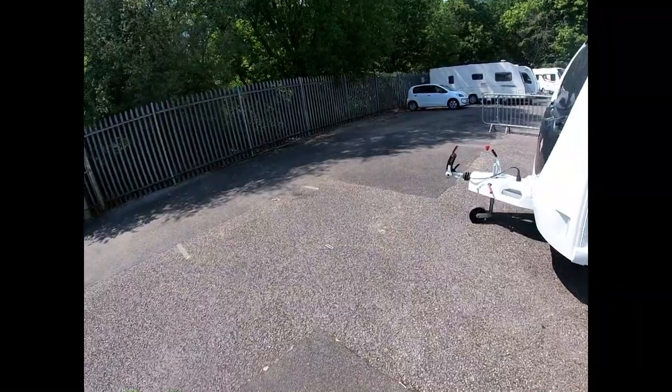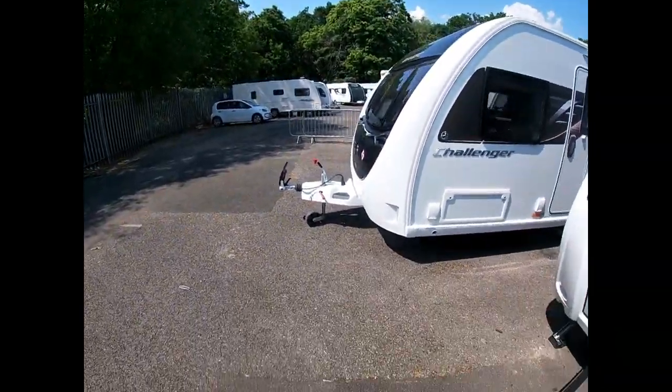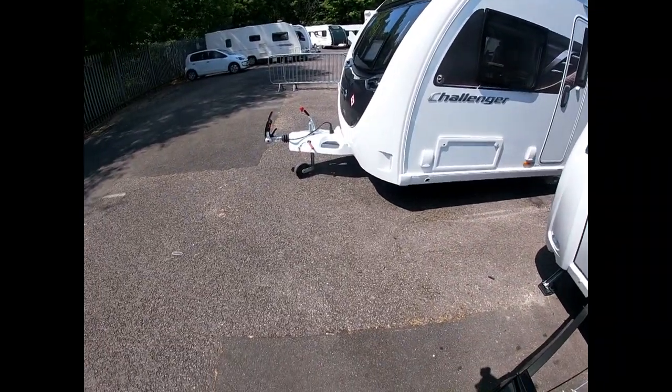Push the button in and press it down. A firm press releases that to the ground. Connected to the end of my handbrake is my breakaway cable. The breakaway cable connects around the tow ball of my tow vehicle, or to an eye on the tow ball